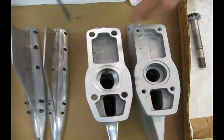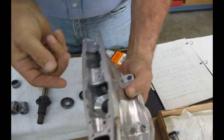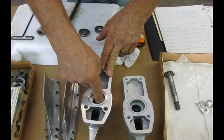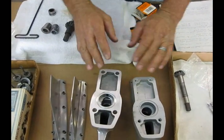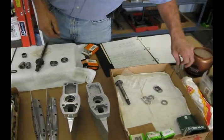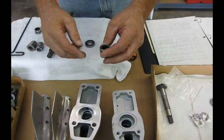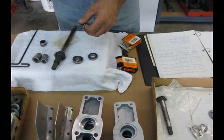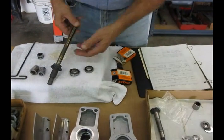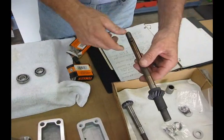When the gears turn, this right here will actually capture the sling of the diagonal gears and send just a gauze of oil up to the top, which will actually wet the inside of this rolling element bearing and then fall back down. It has to come back down through your tower shaft needle bearing. What we wind up with is just superb oiling in the lower units, and all that bluing of the shafts and such disappears.